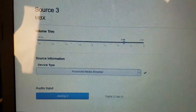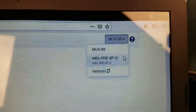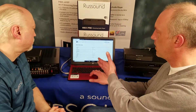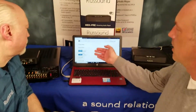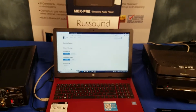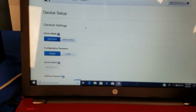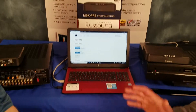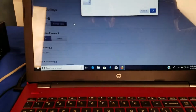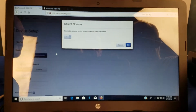That's it for the MCA. And then the next thing — if you look in the right-hand corner, I can toggle between multiple devices on the same network. There's my MBX Pre. So you go into your MBX Pre. Once it's unlocked, you take it through the basic setups. This is the key setup: you choose Setup. Notice the device mode right here — it says Zone Mode. It comes pre-configured that way, so you could take it out of the box, unlock it, plug it into an amp and use it. But in this case, because it's being used with an MCA and the Russound app and the MCA are working to control this, you want to put it in Source Mode.